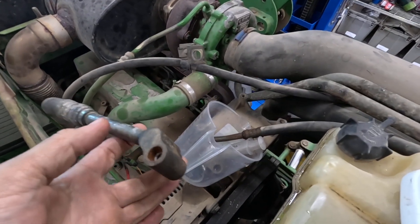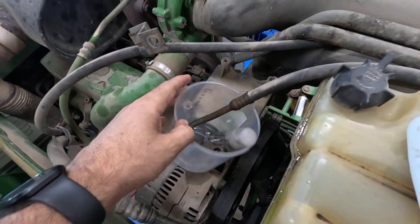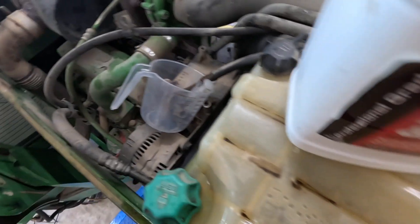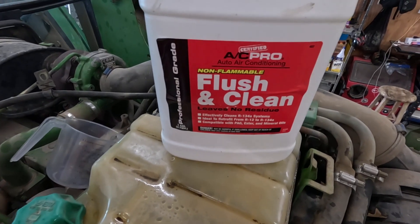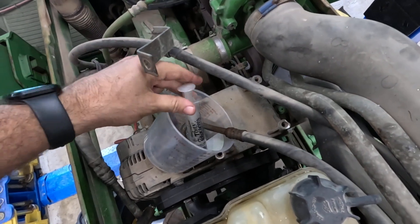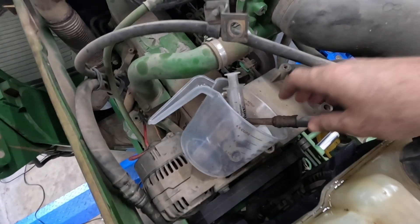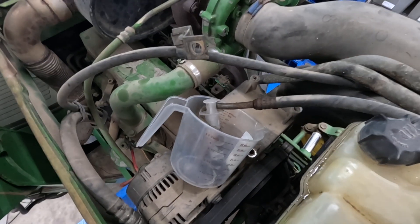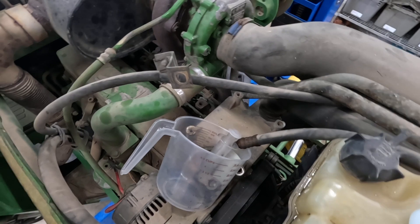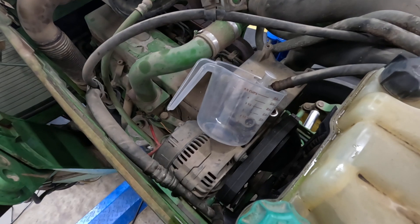So I put compressed air inside the lines after removing the compressor and there was indeed a clog. I couldn't blow air in either end. So I used what I always use — AC Pro flush. Any type of flush and clean will work real well. I generally use a syringe and put in quite a bit, and you want it to stay in the lines for at least 10 minutes. After about five minutes I put some more in with the syringe and it busted straight through — so it was actually flowing. I've let it sit for a little bit and I'm going to blow it out with air, check all the lines, make sure we're good to go.